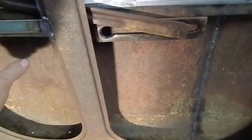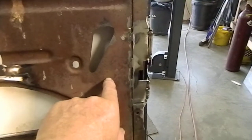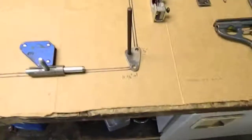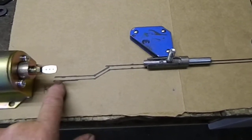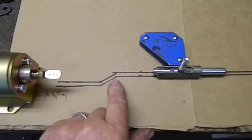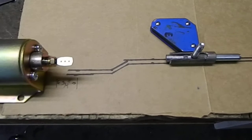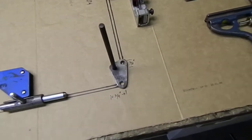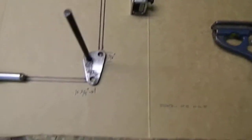The slide should be right about here, just above your leg. The solenoid will be mounted over here, and the bell crank will be mounted here with an arm coming up to the bear claw. I've got it all figured out on my cardboard pattern. The connecting rods will be quarter-inch steel rods, and there's a Z-bend in them to allow a little flex if the solenoid pulls too hard — though it shouldn't, since three-quarters of an inch is all it'll pull, and that's all it requires to release the door latch.